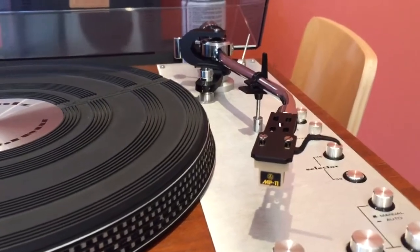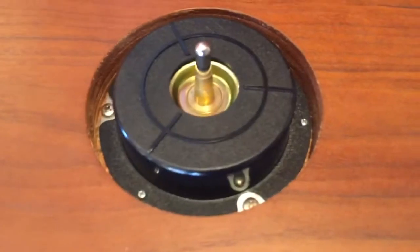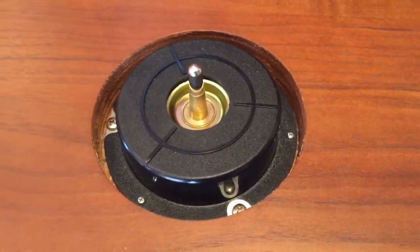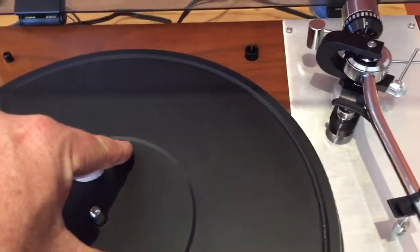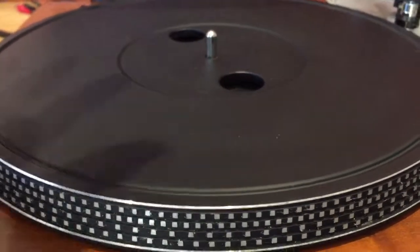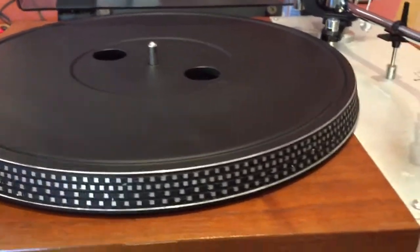Otherwise this deck is really nice. We had to lubricate the motor — the platter comes off, the motor sits underneath that plastic cover, the cover comes off, and the rotor comes out quite easily. You clean the bearing well and add some new synthetic bearing oil. We always use synthetic bearing oil here at Liquid Audio — it's the only thing I'll use. The platter goes back on very carefully once the rotor sits back in the motor, and this can take quite some time — it took an hour today for the air to be expelled from the bearing naturally.